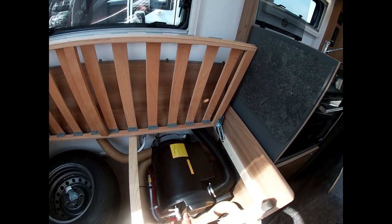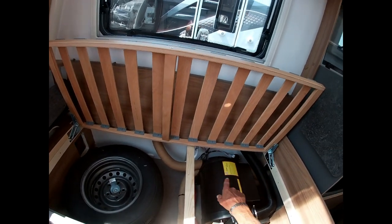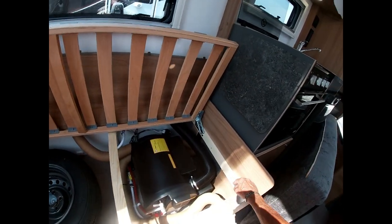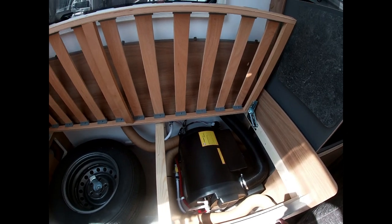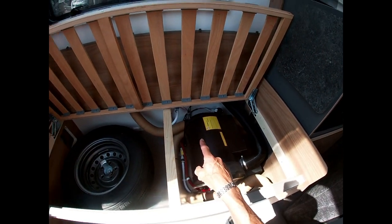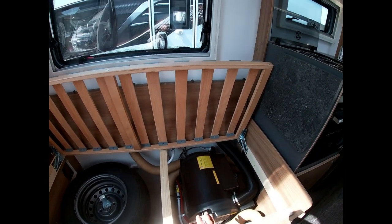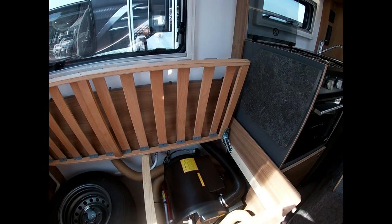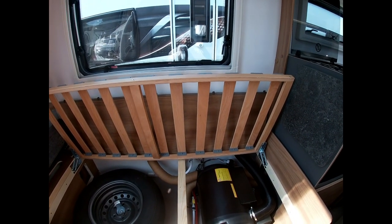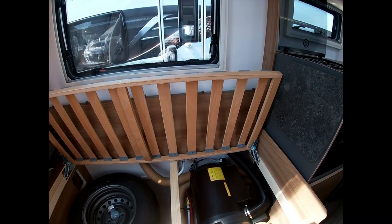And there's our boiler. Okay, so the boiler here is a blown air heating system. There's the flue coming out there, and then it goes off through trunking systems around the van, out through there, blows the hot air. Very efficient, very effective heating system. Your water comes in through there and around the system. That boiler holds your water for heating your hot water. Okay, so what it does, a bit like an old-fashioned immersion heater, it puts cold water in the bottom, pushes the hot water out the top when we select hot water.